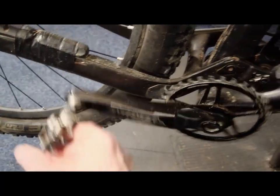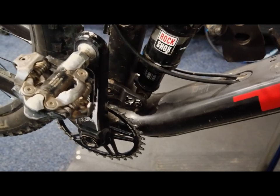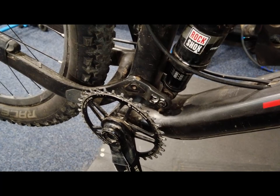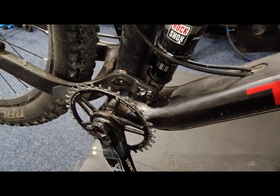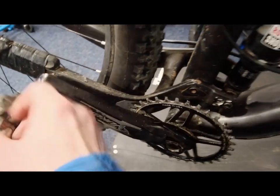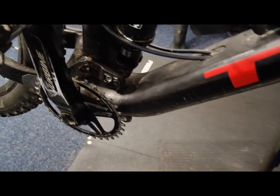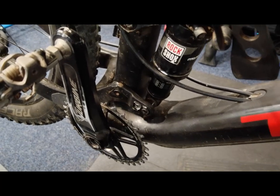So we've got a couple of watts more losses in there. I assure you that a solid 99% of cyclists, if they popped their chain off for general checks and felt their crank spin like that, they would take action to reduce the friction losses. They'd be inspecting the bearings, probably at minimum doing a full clean and regrease, most likely getting new bearings or correcting an over-tightened preload. No one is going to see their BB like that and go 'yeah, that's cool.' They're going to take action — and yet we're talking that same two watts being introduced by one drivetrain system versus another.